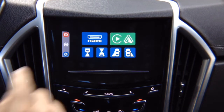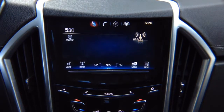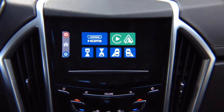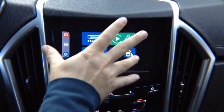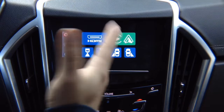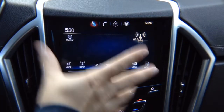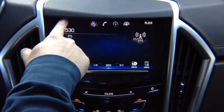To exit out of the interface, press the power button and that goes back to your factory screen, and all your factory features work as before. When you press and hold in the top left corner for a few seconds, it enters the interface and the touchscreen takes over. Nothing in the background will be touched; factory features will still work because we're now controlling the interface with the touchscreen. Keep in mind this is just a screen — same screen as found in your house. Everything you see on here is an image coming from elsewhere in the car. Think of it like your home TV: pressing normally is HDMI input 1, and pressing and holding is HDMI input 2.